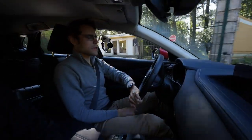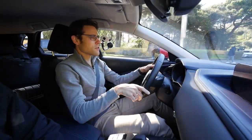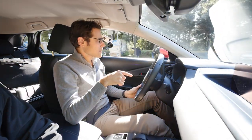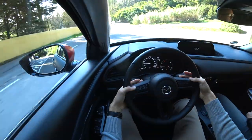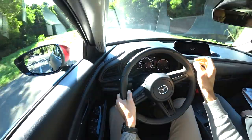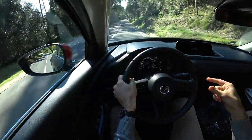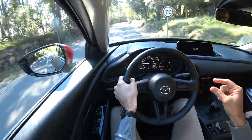At the moment, we cannot adjust anything as for the recuperation modes. There's not a strong recuperation set in at the moment, so the car is rather using this rolling energy. In the final car, you'll be able to adjust the recuperation with the shifting levers, and you can set three different modes of recuperation. But at the moment it's rather rolling, so it doesn't feel much EV alike. When you have this one-pedal feeling with the very harsh recuperation, that's where it feels more electric-vehicle like.